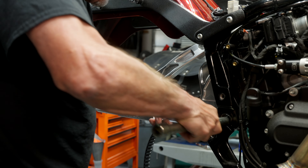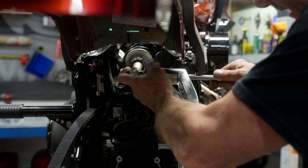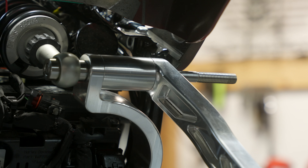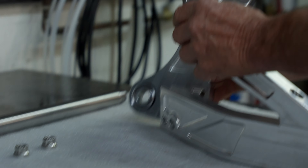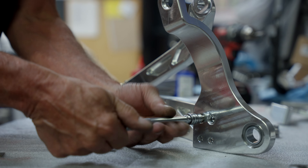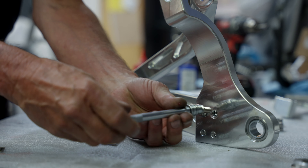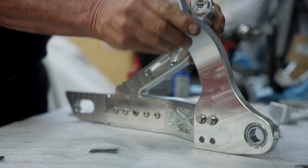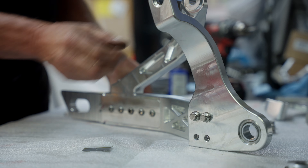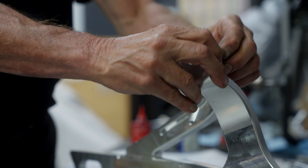It's a slide to main pivot through the right side of the swingarm. I'll slide the shock pivot bolt through the right side of the swingarm. Then on the left side, we're going to put this upper pivot support in place. I'm going to run these two bolts down — not completely tight. We want to retain a little bit of movement in there, because we also have a spacer that allows you to slide the belt in to get around the pulley of the back wheel.